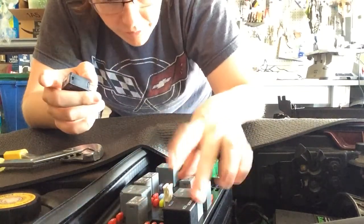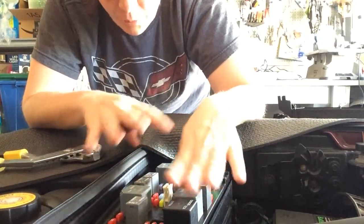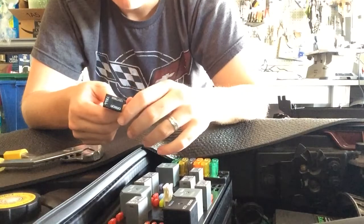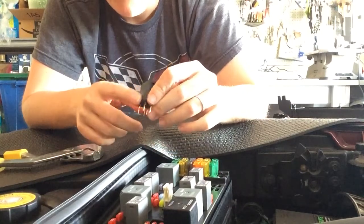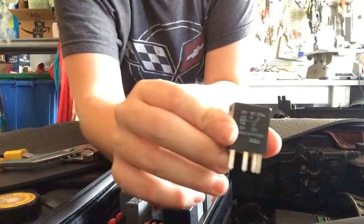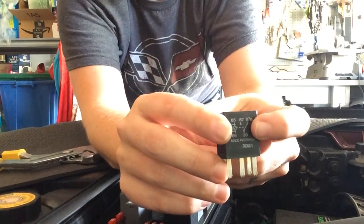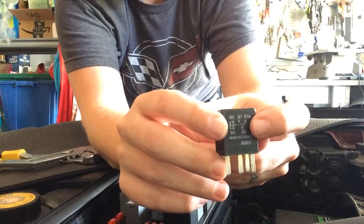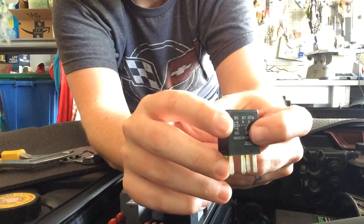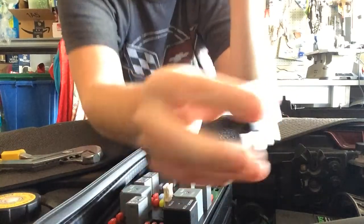is because, and I'll show you the noise, when I unlock it with the key fob, there's kind of this buzzing, almost clicking, hissing sound. So these guys, I learned, make that clicking sound because in order to complete this circuit, you can see it, this little window over here, it's an electromagnet. So right now nothing's operating, but when the relay gets clicked in with the electromagnet, once that activates, this window, this door, like a swinging door, shuts and completes the circuit.